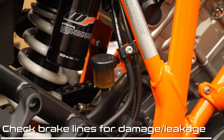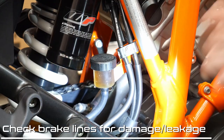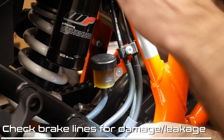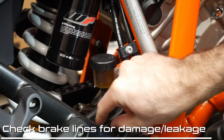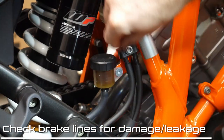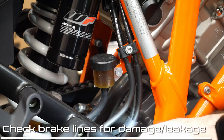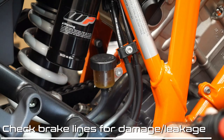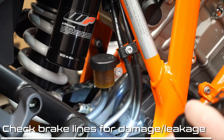I'm going to trace this all the way back to the rear caliper, and then we're going to check the lines in the front for the front brake fluid as well. This is the ABS — there's a bunch of ABS braided brake lines that go up to the ABS system and then come back down from the ABS sensor. We need to check and inspect for leaking, damage, or anything like that on all of these.